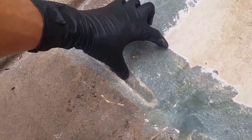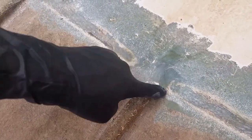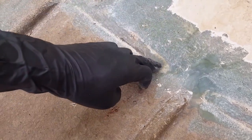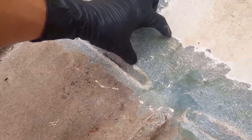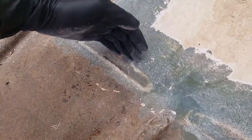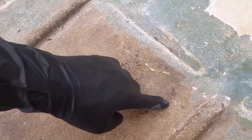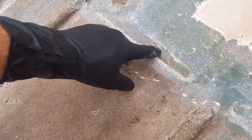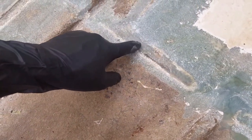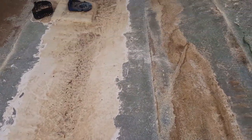We cut that much of the gel coat back, and then this is where the bulkhead is, and this is the pass through where the water goes out, and then this is where the fuel tank was. You want to grind out about 3 inches here, so you can lay your 1708 on this side, and this side I'll probably grind a little bit more, to create a better edge. And then this is leftover grime from the foam that was put in here. I'll grind about 3 inches here. And you have the template already, because you know where the old bulkhead was. So that's where you can start making your mark of where you want to grind.